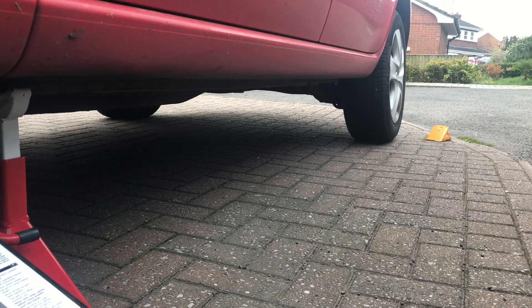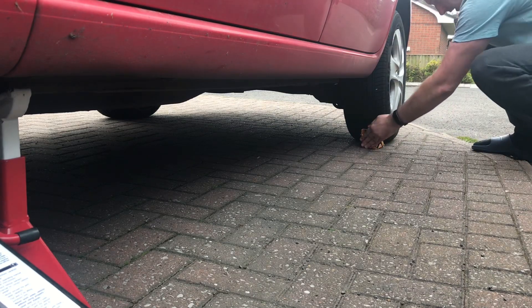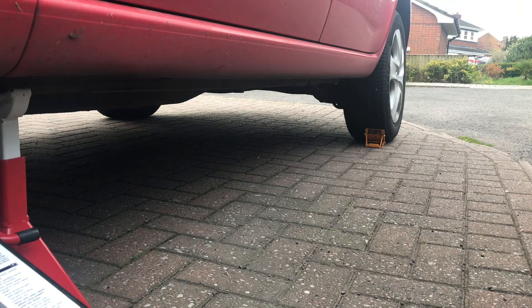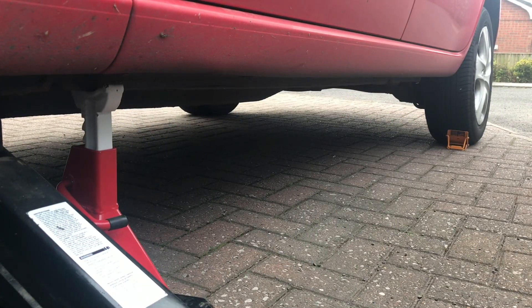Put the tire to the side — wherever the gradient is, if there is a fall it's going to roll forward and hopefully the chock will stop it. You're doing as much as you can. If you're doing anything significant underneath like exhaust systems, perhaps use ramps — I've done a ramps video and I'll stick the link in the description.